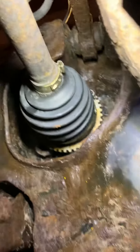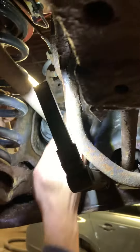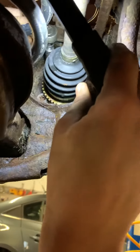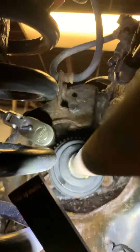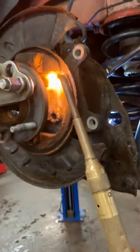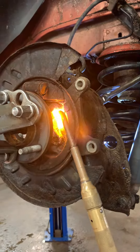You can round it off easily, so what I suggest is — once you get the tool in position and you're ready — grab the torch. If you don't have a torch, you can use a propane torch. You've got to heat it. The only reason I suggest heating it is because if it's too hard to turn, you'll round it out in there, because obviously it's not the right size socket for that bolt. So throw a little heat on it just to make sure it comes off easily. Just heat it around the hub, get it nice and hot so that you don't have to use a lot of force to remove the bolt.